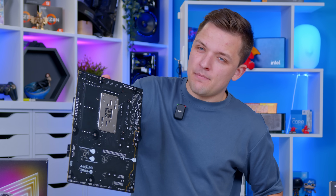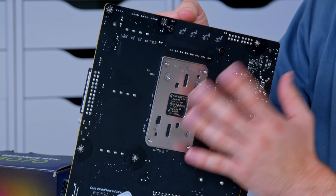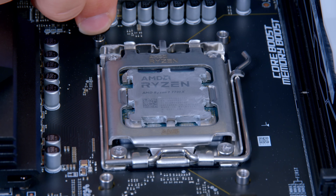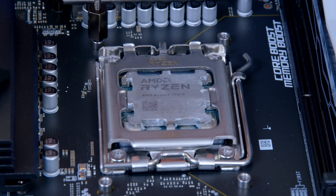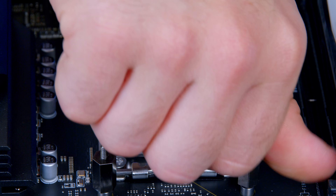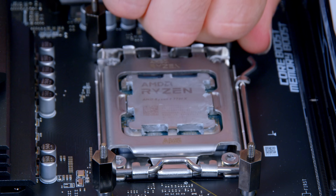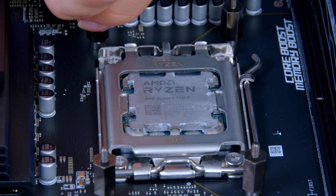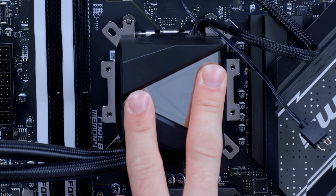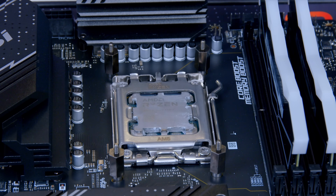One of the advantages of AMD is that the backplate is pre-built into the motherboard. For an AMD mounting config, you'll want the posts that install onto the motherboard and the corresponding thumb screws to fasten and secure the cooler. You should have four of each. Simply screw each post into the threads around the CPU socket — it doesn't matter what order, just make sure they're nice and tight, as this is what you'll be installing the water block onto. A quick test fit illustrates how the cooler is going to fix on and how the thumb screws will go over the threads.